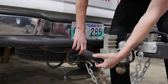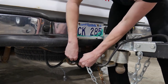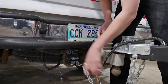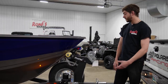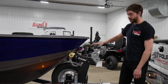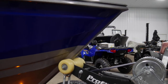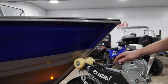This also only goes in one way — you have a slot up top, you push that in all the way, make sure it's there, and then this will sit on top and lock it in place. You want to make sure everything's connected, all these are hooked up. Part of your safety checklist for traveling with your boat — you're going to make sure that your winch is really tight with the hook on your boat here up against the roller. You want to make sure that it is all the way, it won't move, and this won't bounce when you're going down the highway.